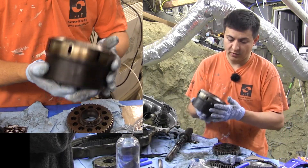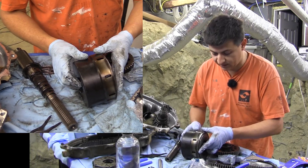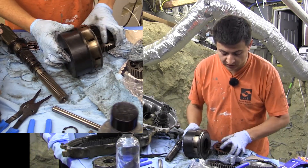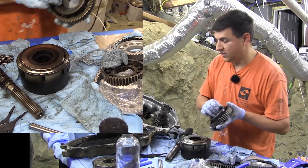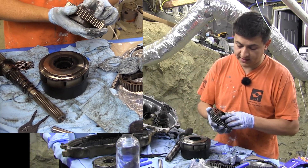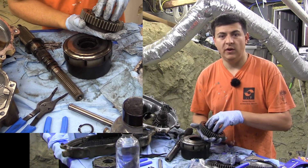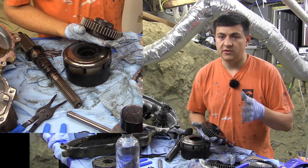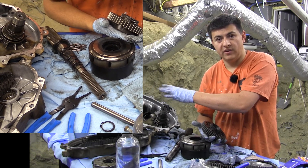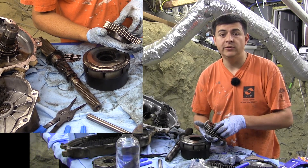This particular unit is about a $400 replacement part inside this transfer case, so we're not going to bother replacing it even though I'm pretty sure it's defective. It's only required for four high in this transfer case. In four low, the transfer case simply engages a dog clutch right here to these teeth on this ring, and that causes the transfer case to lock the front and rear output shafts together. When you're in four low, because this unit is locked one-to-one front and rear, you should stick to soft surfaces only.